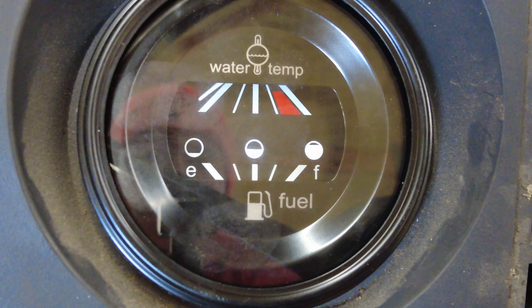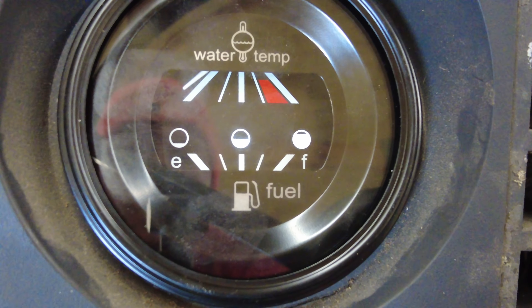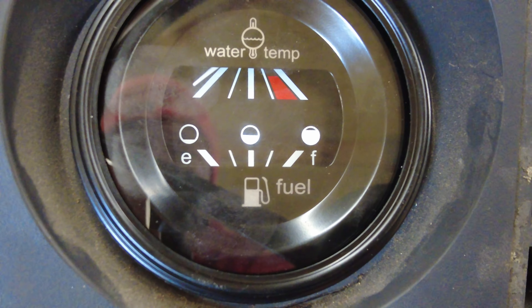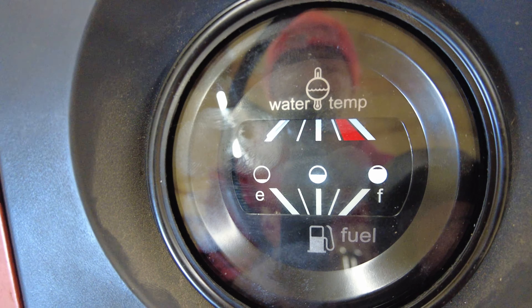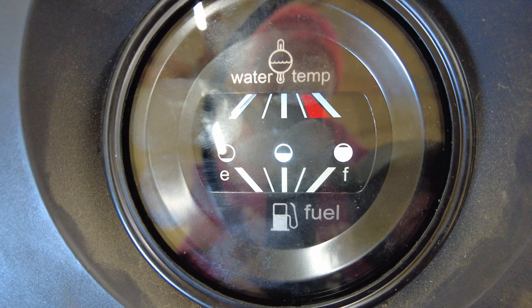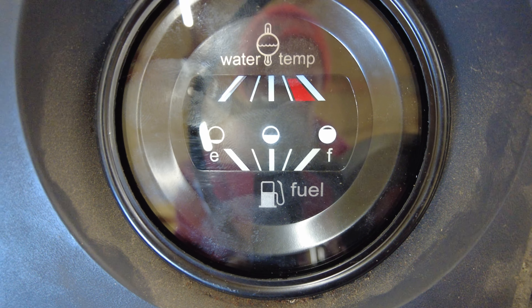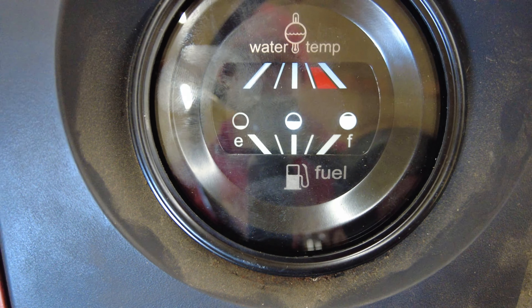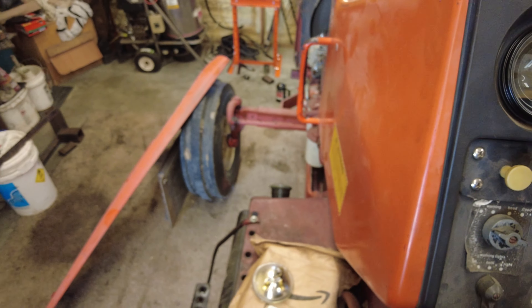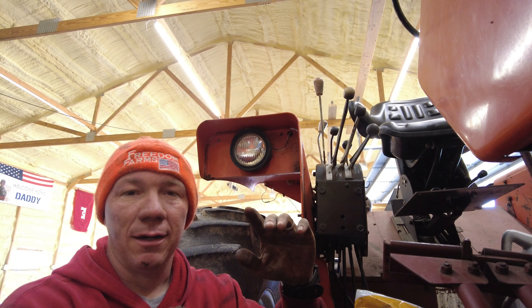The gauge has moved a little bit. For the water temp I'm actually going to start this up and let it run. The fuel gauge though — I think the sending unit's bad, or at least I hope it is, otherwise I've got something going on with the gauge or the wiring. Yeah, I think the temp gauge is working but I think it only works while it's running because you can see it's actually moved up now. I'm not real sure why it only works when running, but interesting.